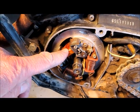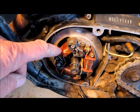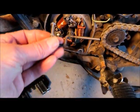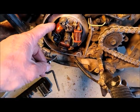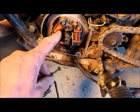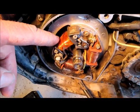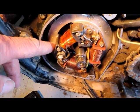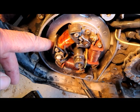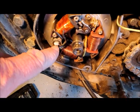Then I rewound the coil. You don't have to be super neat with it — you're just trying to fit it on there. The first drill I did kind of by hand, then the rest I had a little apparatus screwed through one of the holes and put it on a drill and spun it up. You want to leave some wire out the back end on your first run to work with, and when you're done you'll need some to hook up to the condenser. I re-spun it, rechecked my resistance — it was good, 1.3. Then I soldered the lead to the ground lug and soldered this end to the condenser.